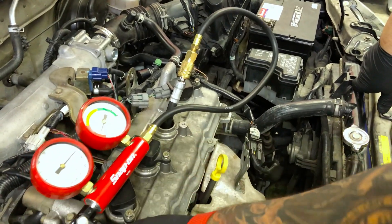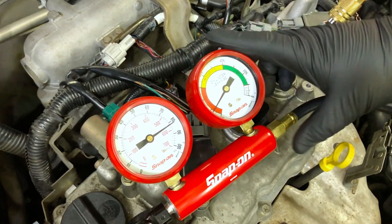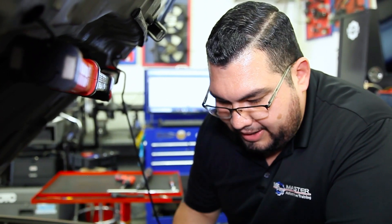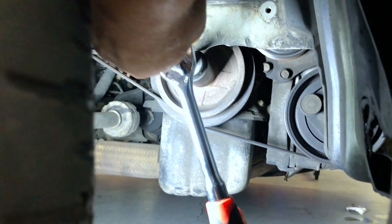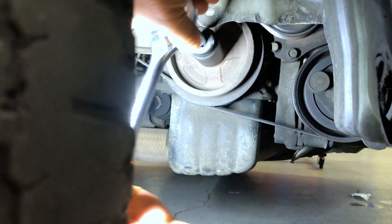Based off of what I'm seeing right now, my tester is telling me I have over 80% loss of volume in this cylinder. Because this engine is not misfiring, I know this is incorrect. What this is telling me is that the piston got pushed down because I didn't have it all the way up when I set this up. So let me go back and reset it. Always remember — if you can't get the engine to cooperate, you can always go down and by hand spin the crankshaft using the proper socket and ratchet. Always make sure you remove the key from the ignition switch so nobody accidentally cranks the engine while you have your hands near the crankshaft pulley and the belt. It's all about safety. We're hand cranking it — once we hear the whistle we know the cylinder is at top dead center and then we can retest.